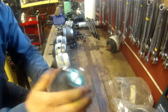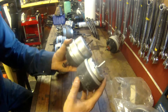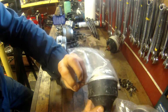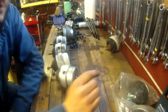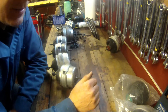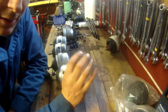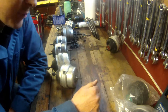On the other end of the spectrum, here are brand new mounts for a B5 A4 1.8T. The mounting heights are identical across applications. What a lot of guys do is order the B5 RS4 mounts — those are solid rubber rather than liquid-filled, so they're quite a bit stiffer and give a lot more support to the motor. If you're making big power or doing anything on the track, you'll probably want those RS4 solid rubber mounts to keep your motor planted better.